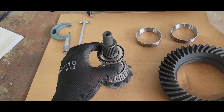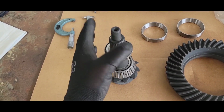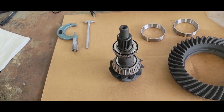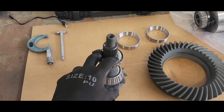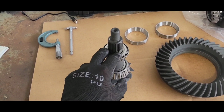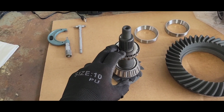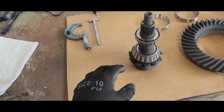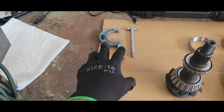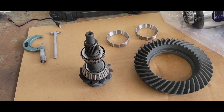You give them enough clearance, they'll face out, but they could be off axis still, they can shift. So if you're going to use an air tool, use something kind of less aggressive, like a little flappy wheel. Don't use stones, don't use carbide burrs. Use a sanding grit abrasive and take out little amounts. It's great if you have some tools to measure it so you know where you're at.